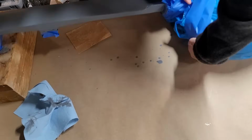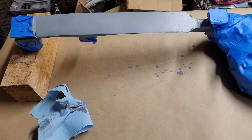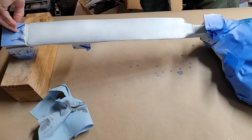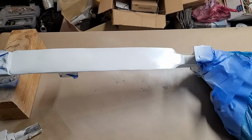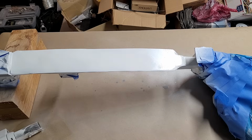All right, for the top coats, I am using an epoxy spray paint. I'm doing a little bit of scuffing here with a Scotch-Brite and then final cleanup with some acetone to clean up any dust. And then I'm doing 6 very light coats rather than any kind of thick coat, which is what they advise for this paint. They want you to do up to 6 coats within 1 hour with 10 minutes waiting for dry in between individual coats. So that's what I'm doing here.